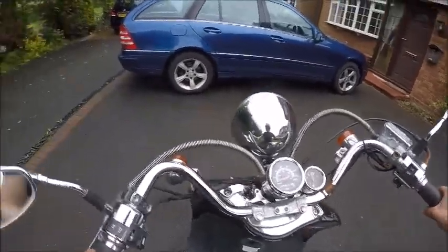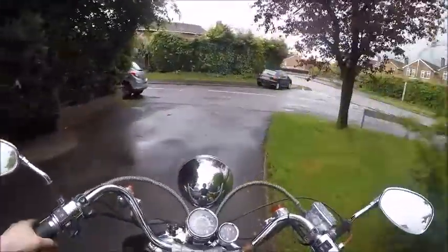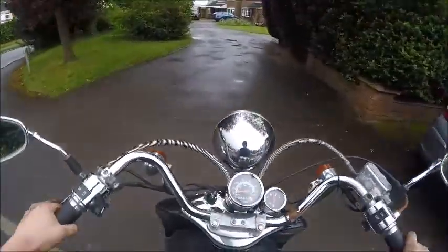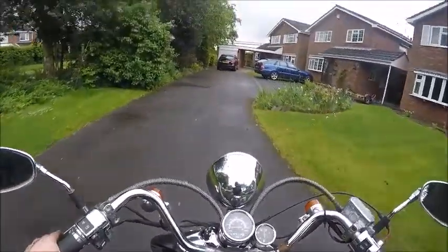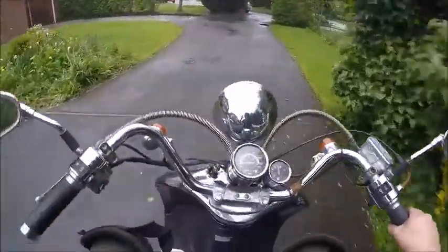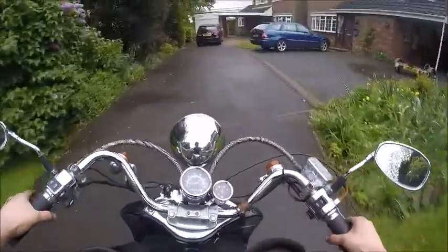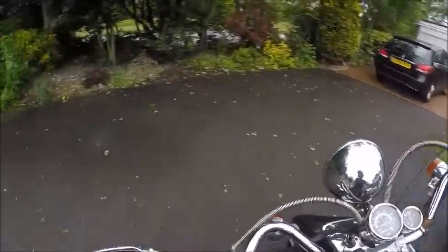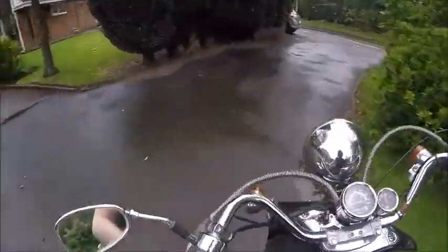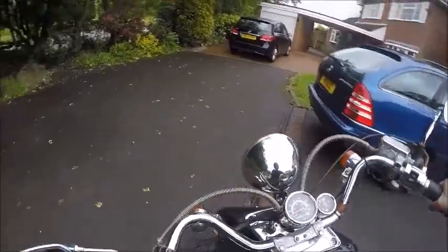It turned out I thought the head bolts were stripped out of the head, but turns out the bolts are just not there. Usually you take the nut off and the bolt stays in the head, but the bolts were gone - there was one sort of half a bolt sort of holding it on and that was it. So I've put some new bolts in and it's sweet. Very pleased, quite shocked, but it works. I've just got to carry on messing around with it but that's probably all for today. The rest of it is pretty boring, stuff like trying to peel the stupid stickers off. If you want to see what happens with this scooter, make sure you hit subscribe and until next time, peace.